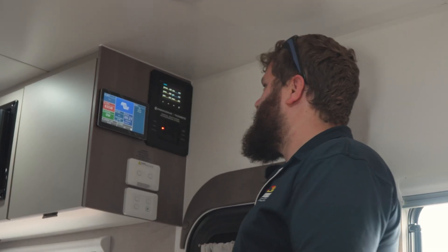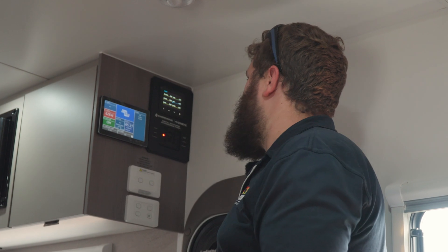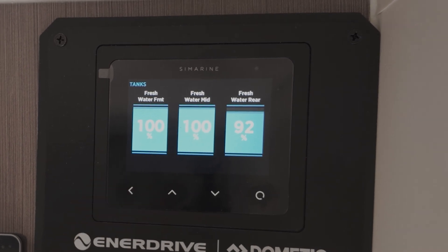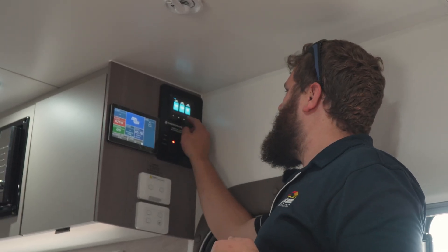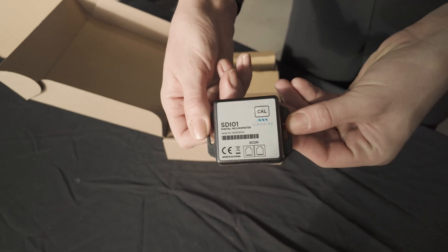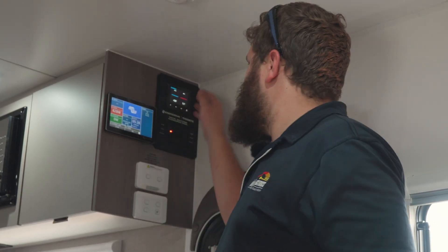As well as all of our other 12-volt accessories, we actually have everything listed separately so we can really pinpoint exactly where everything is, what it's doing, and what's going on with it. We've also got all of our water tanks through here - two fresh and one grey water tank - and we can see very accurately how full or empty they are. We've also got an inclinometer, so you can see your pitch and roll - no need for a little level on your drawbar. We've got a full digital inclinometer so you can get your van sitting perfectly flat and level. Simarine now also has experimental features which you can monitor remotely as well, so for this customer they can monitor everything via the onboard Wi-Fi or Starlink from anywhere in Australia.